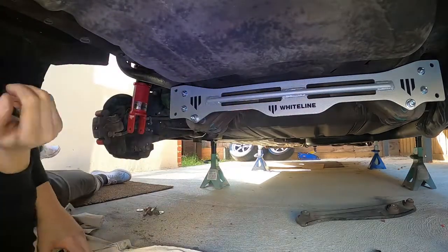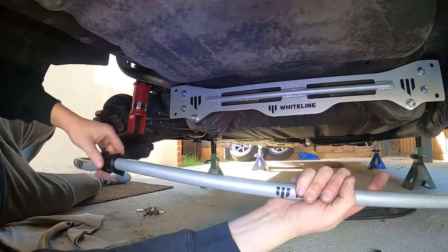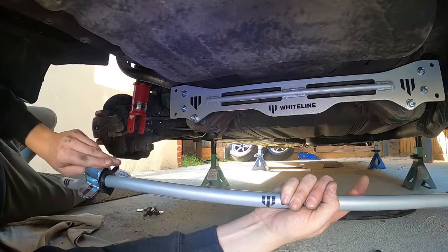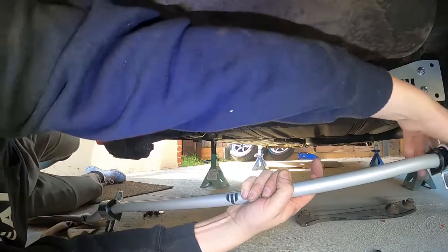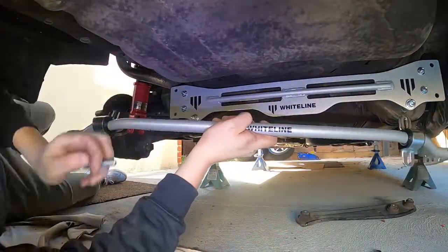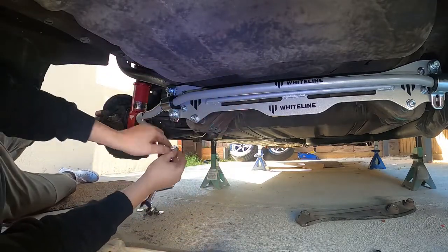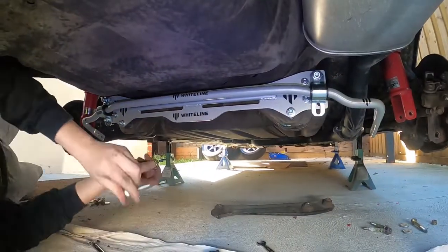It came with a packet of grease but it also says these are greaseless bushing technology — they've got a special crisscross pattern on them. I'm not going to grease them. I put the split at the top so when the weight's on it, it's not splitting at the bottom — it's holding it in there. I'm going to bang a bolt in the top of each one. It's pretty heavy. Turns out they're a 17mm, quite a big jump up in size, but got to be strong to hold the sway bar on.